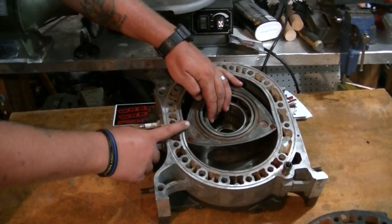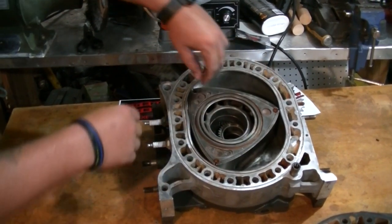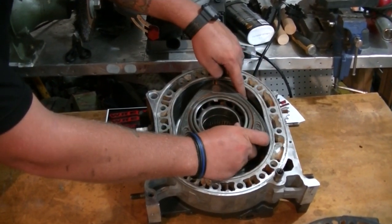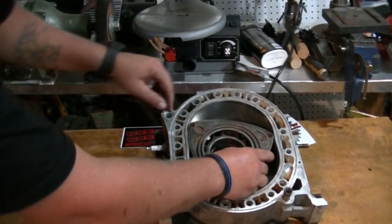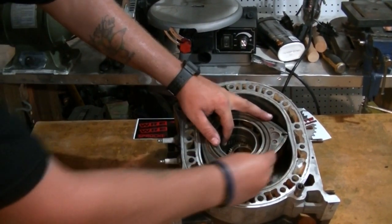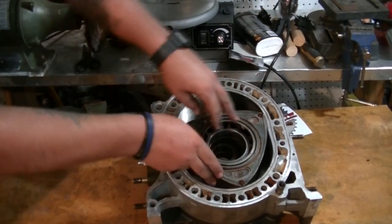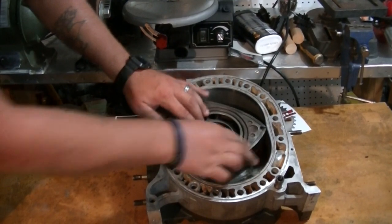As you will notice, as the rotor travels in a motion, we're looking at this backwards, the rotor will come along to the exhaust port, will push out, comes back around along to the intake side, pulls air in via suction, sealed process, comes around, in turn, compresses, combusts, follows the motion around, and comes into the exhaust port again. So this is a constant cycle in which the rotor never changes directions. It's constantly spinning in the same direction at all times.